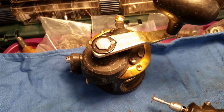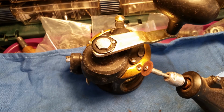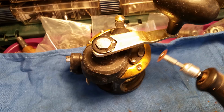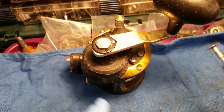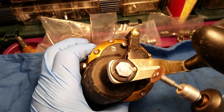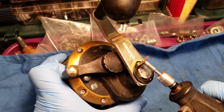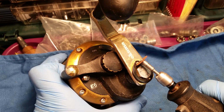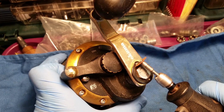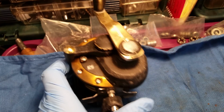So these cutoff wheels for a Dremel, this one here is pretty small. Normally they're about that big. But you save the old ones so when you cut, you don't cut as wide of a slot and mess up the screw. So we're going to go and give this a try. Okay, and there is our slot.